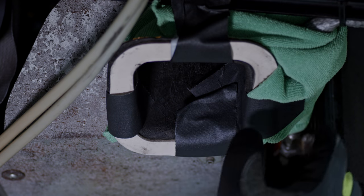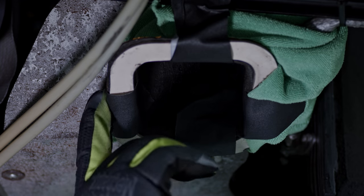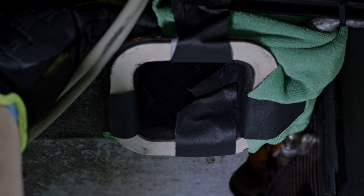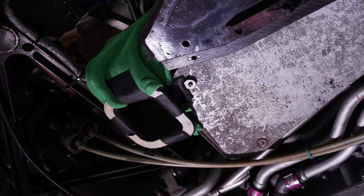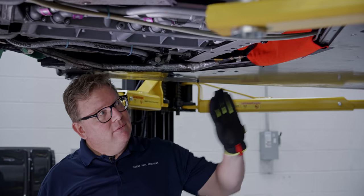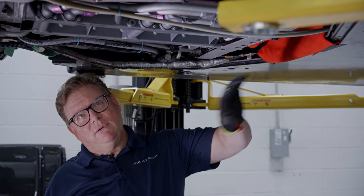One of the things we had to do before we started blasting was wrap anything covered in gold foil that was within the shot of the wand — just taped these off with a little gaffer tape. So these two ducts here and the front of the firewall were also wrapped. This is original gold foil here. I'm not going to be the guy that blew it off the parts. Better to err on the side of caution. I can now clean the gold foil in a normal way.